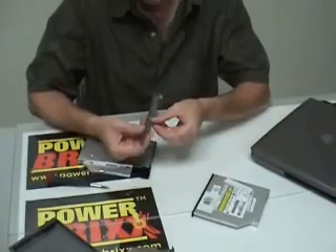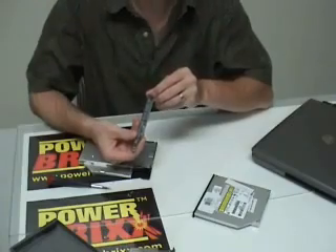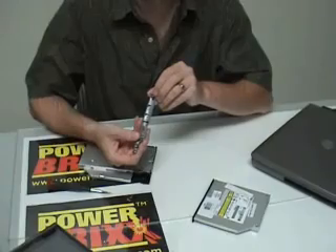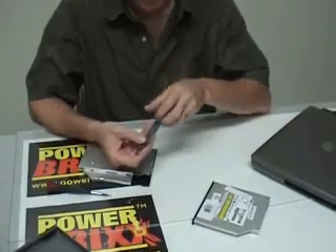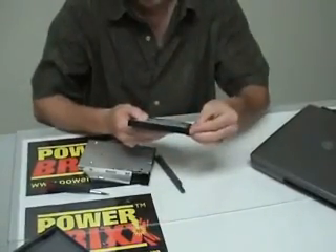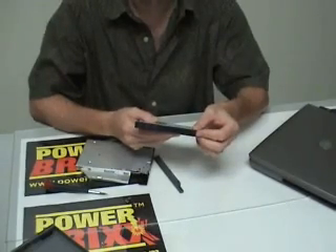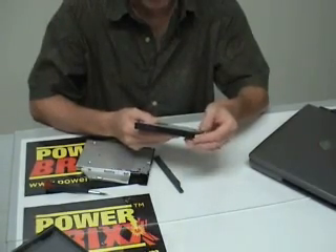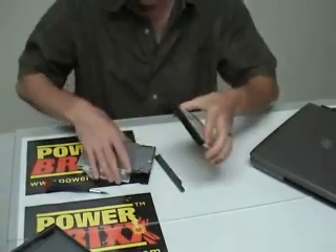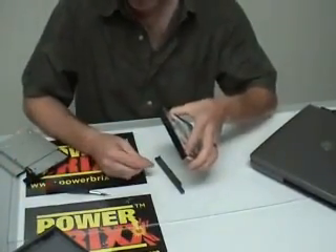This is what's really important: there are a lot of different bezels out there, and if the bezel is not the same as the one on your computer, you are not going to be able to transfer your faceplate onto the new replacement drive. That's where it could be important to know whether the faceplate is the exact same width and height as the drive itself — if your computer would accept it, it would install and function fine, and it might save you a lot of money over going to the manufacturer to buy one with the correct faceplate.